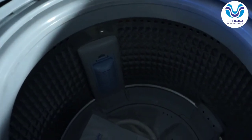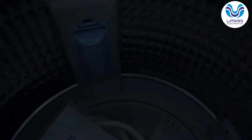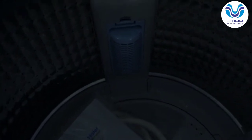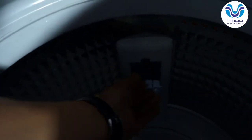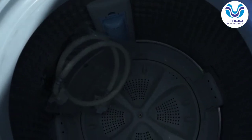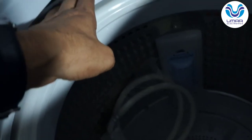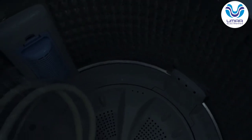Let's review the washing machine inside. This has a pillow drum — this is a patented shape. It is fabric friendly. There are two lint filters — one is on the side. These lint filters are detachable and you have to clean them from time to time, because the fluff from the clothes collects there. At the bottom is the pulsator, also called the impeller. On the back wall, you will see micro holes — water from the inside moves outward along with the foam.